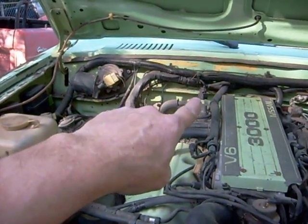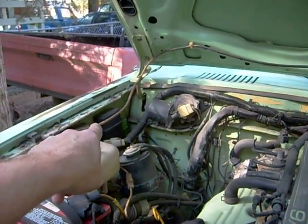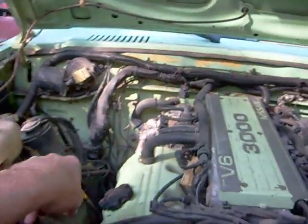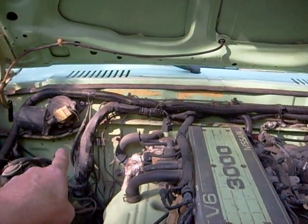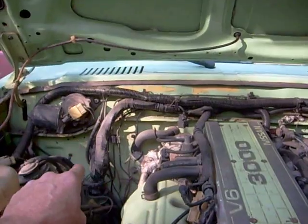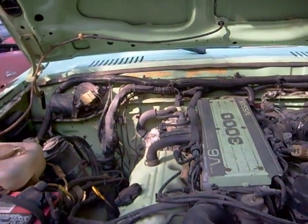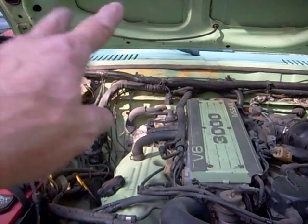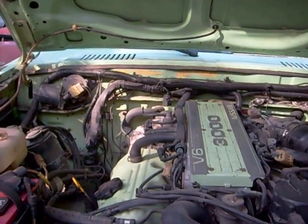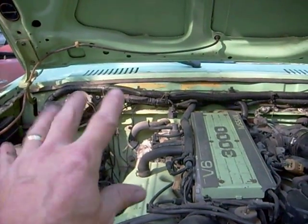The vapor canister and EGR are in place. The relay box off the car is up over there for the ECCS system. The harness comes up over the top. I mounted the control unit up as high as it would go behind the glove box — it's literally almost touching the cowling on the inside of the truck cab. It's mounted in four little rubber grommets in a plastic tray, like the old 280Z turbo control units were mounted, to handle the vibration.